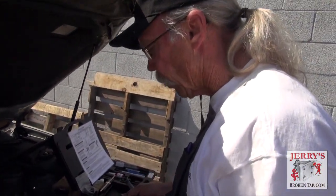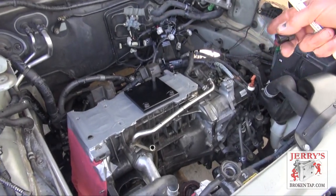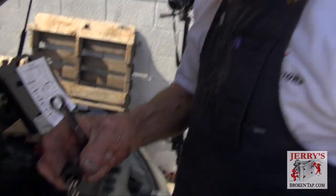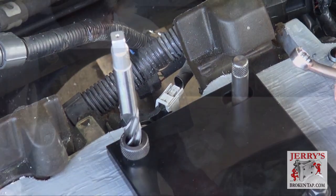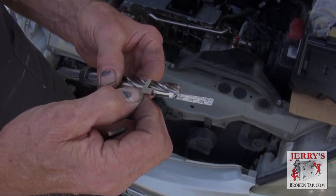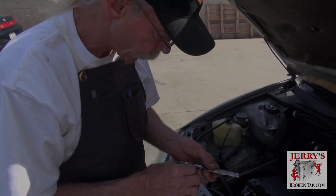At this point I have the guide plate or fixture on location using the locating pin and two bolts going into good threads, holding this plate in position and preparing it for machining. We install a bushing that fits this core drill, which does the drilling and counterboring for this job. The bushing slips into this hole, the drill drops down inside, and we drill our hole. TimeSert provides a scale that you use to measure from the shoulder on this core drill up to where you want the drill to stop. You lock the collar in place with a set screw.